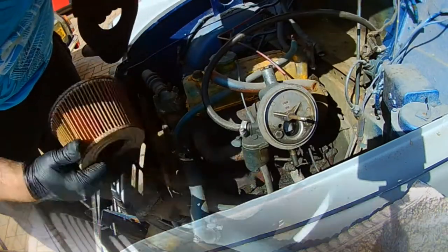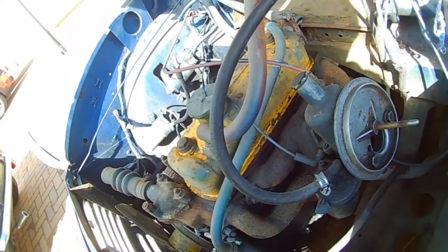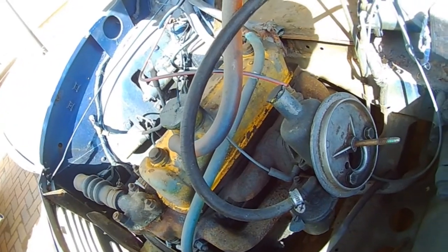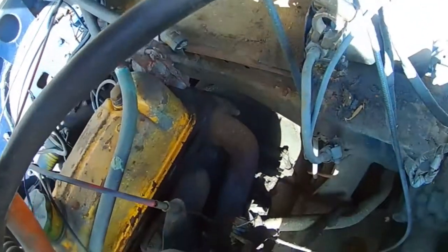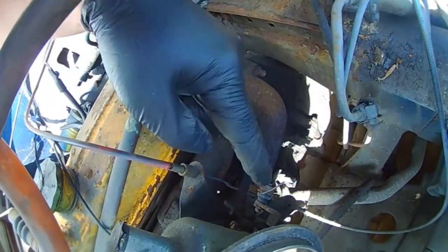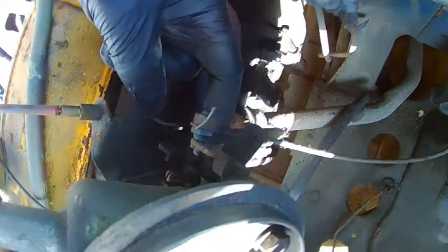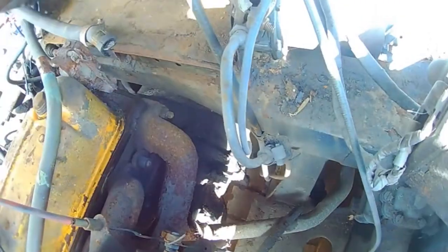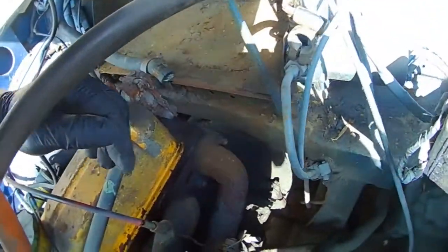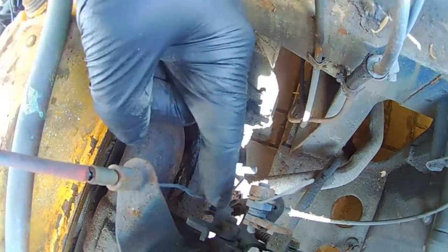So there we go. I'm going to leave the manifold intact but I'm going to take the carburetor off. The carburetor has quite a few connections that need to come off first, starting at the back. I have this, which is the choke cable — one single nut here. If I can follow that back down here, up here and through here.